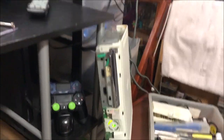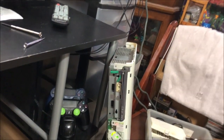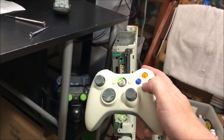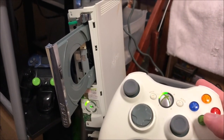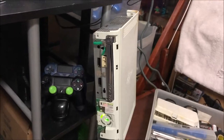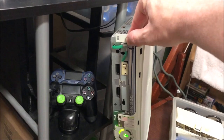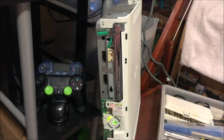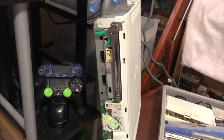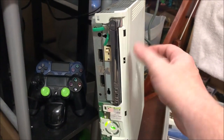Welcome back to the Xbox saga. I have this thing taken apart and this has been like a three-video kind of thing we've been doing. We can use the controller to open the disk tray and we can use the controller to close the disk tray. But when we try to actually use the button, it doesn't work. Usually when you've got a gummed-up disk drive — whether the belts are bad or the rails have got dog hair wrapped around them — you'll hear it. It'll start to run and then it won't open.